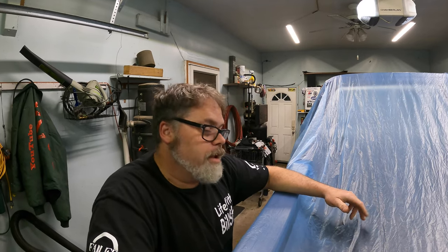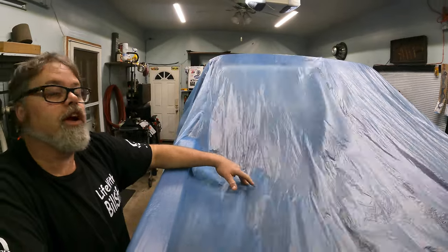I'm done with brushing. I ordered myself up a sprayer and we're going to mix the old paint up with some acetone and spray into the truck. I know I'm going to get some overspray on the truck — you're bound to — but I'm going to maybe wet sand this thing and buff it anyway, so I think we'll be okay.